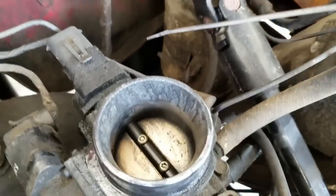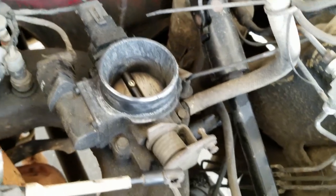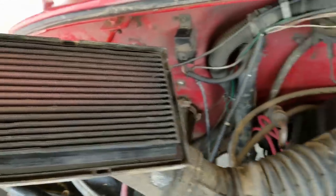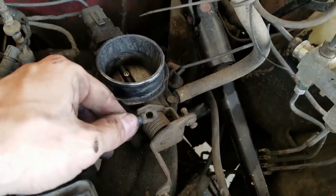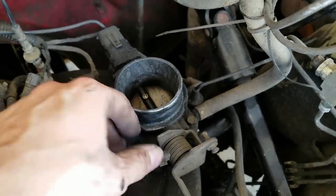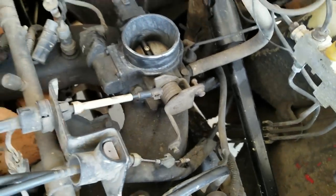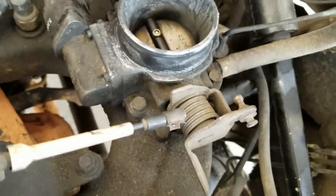Let's give them a little bit more to be mad about. Here is the old intake, and as you can see I have copious amounts of oil and gunk that flows into this every single day — I believe there's excessive blow-by, and you can tell by my air filter which is also black in regions. That's a project for another day. I've disconnected this guy here — this is what connects your gas pedal to your engine so you put your foot down and the engine goes vroom. And this guy here — ignore the staples, that's another story — this is what connects your input to your transmission, that's the kickdown cable which lets it know when to downshift.